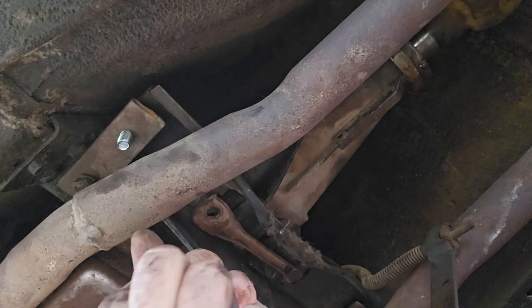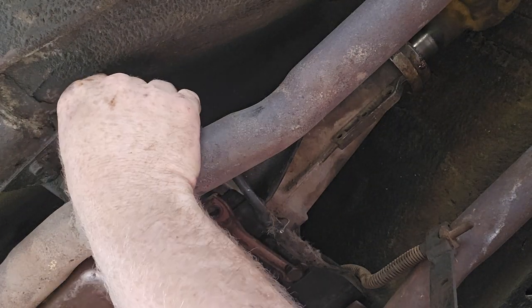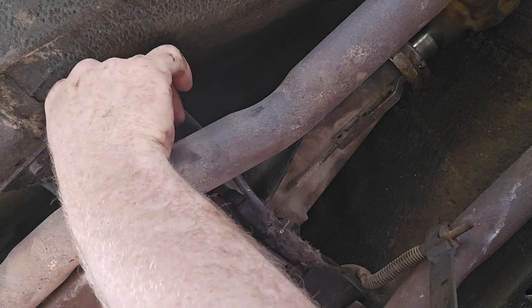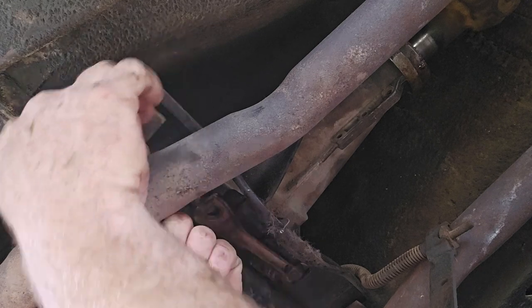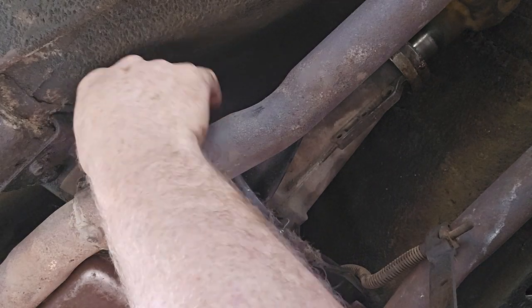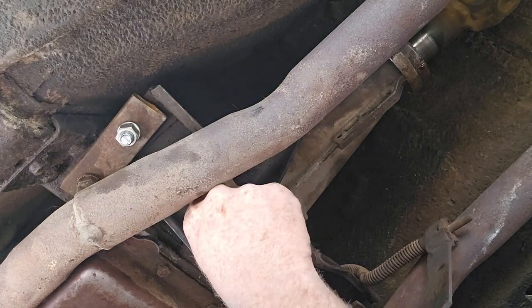But yeah, this is literally the whole thing, everybody. Oh man, you can't hook up the crossmember. The big problem with this car is it's a unibody, so you can't just move stuff and bolt into stuff. It has these spots here that are specially reinforced for the crossmember. So that's the big battle here.